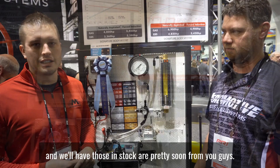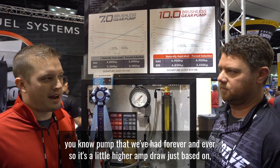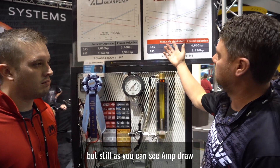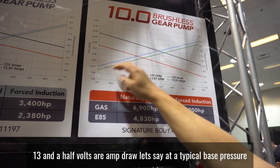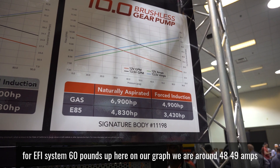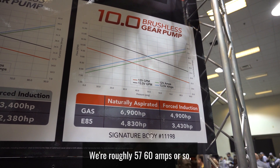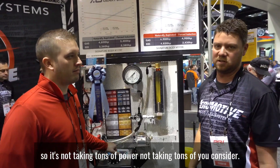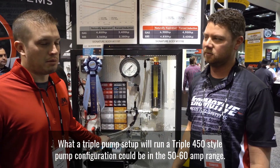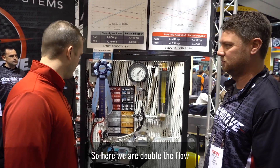One of the other cool things about this pump is the amperage. It doesn't really pull any more amperage than a traditional pump. It's a little higher amp draw just based on flowing twice the amount of fuel, so working a little harder. At 13.5 volts and 60 psi base pressure, you're roughly around 48 to 49 amps. Even at 90 pounds of pressure at wide open throttle, you're roughly 57 to 60 amps. A triple 450-style pump configuration could be in that 50 to 60 amp range anyway — so about the same amperage as other options that flow less, while delivering double the flow.